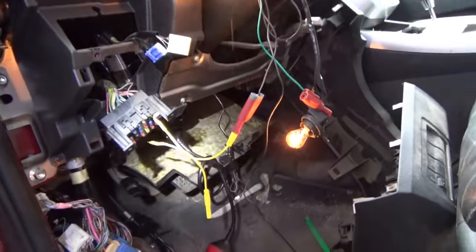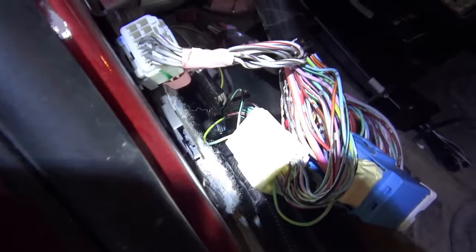The all-wheel drive control module path from the meter fuse goes through green and red, green and yellow, then green and black toward the rear harness. We can snip this wire, see if the car starts and runs, and pull into the shop to do a better visual inspection underneath. Shop owner says let's just drive it in the garage, quickest way possible. Snipped the green and black — but still no prindle, TCM still offline, 4x4 still offline, ABS still offline. We didn't gain anything there.